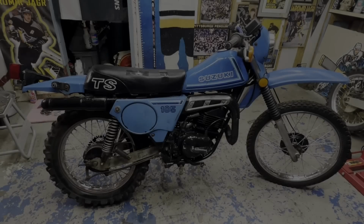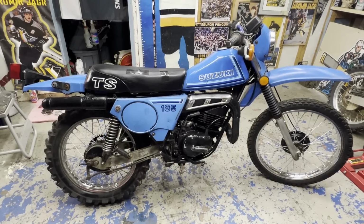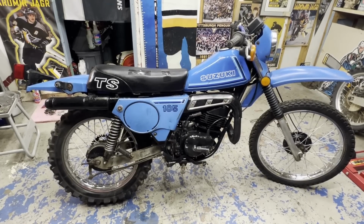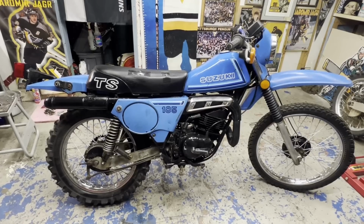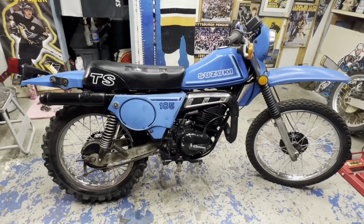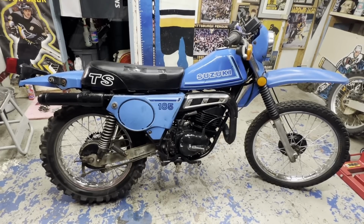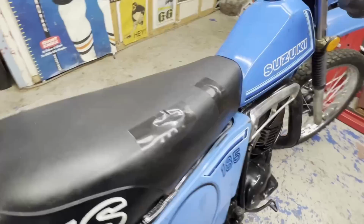All right guys, that's where I'm going to leave off on this video. The carburetor I think still needs a little bit of tweaking. It is running a little bit lean I think, having the idle hang and just some erratic idling issues too. So I'm going to probably take that off, get a better look at that. I'm going to fix that petcock and just make sure that it's not running on the lean side, because I think that's where the issue is right now. So we're going to get that carburetor off here next I think.